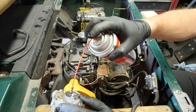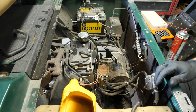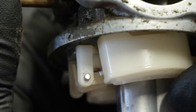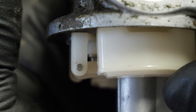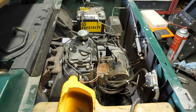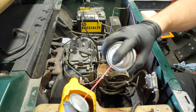The carb's not blocked — it does work, at least from what we can see here. Now it's working like it should. You see that little silvery bit in the middle? See how it's going up and down? When the valve itself bottoms out into its seat, and if the bowl overfills, the spring-loaded plunger allows the float to go all the way up. That was the main issue with this thing. Watch the rubber O-rings — try not to get any carburetor cleaner on those if you can help it.